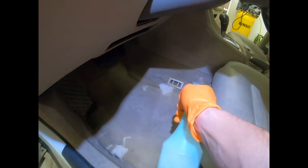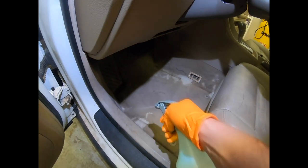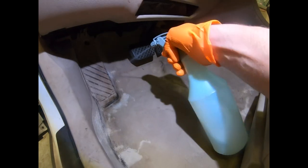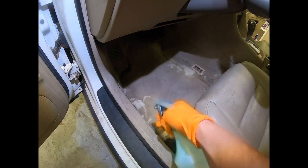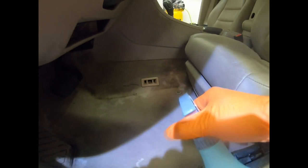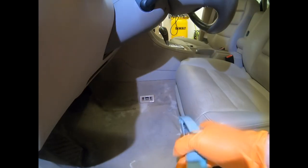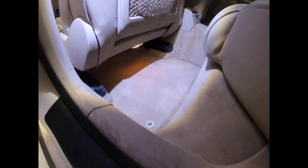What I'm doing here is targeting all the notorious areas where I find ice melt in vehicles in Utah — corners, right along the edges of floor mats, over on the right-hand side by the driver's pedal. Urine neutralizer is a low pH. It's my understanding that ice melt being salt is a higher pH, so you've got to neutralize it. You do want to agitate it and then extract it — rinse it out before you even clean the carpets.